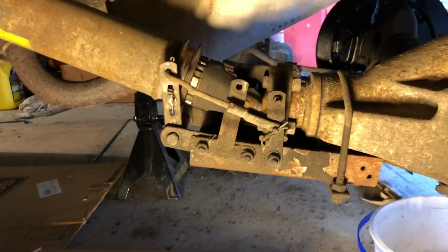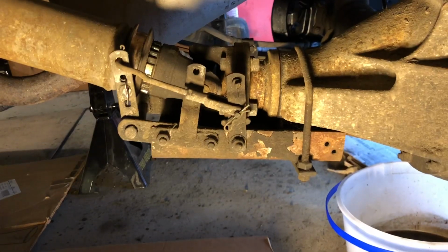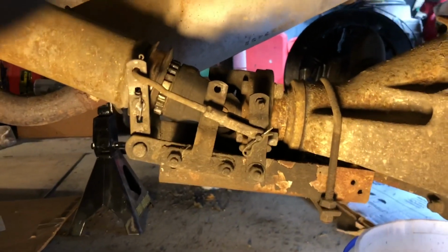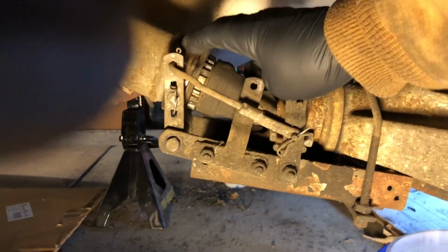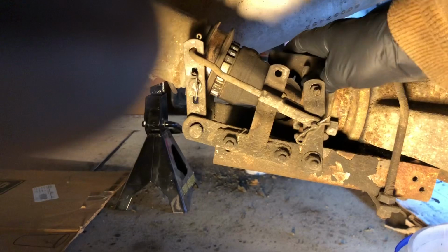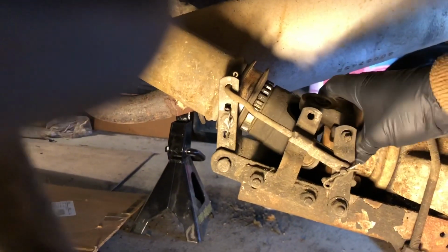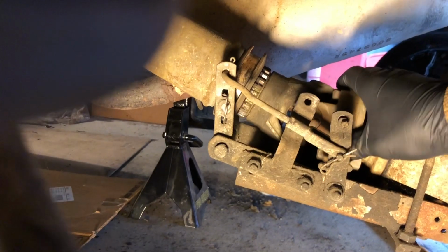So here is the driveline disconnect that was added to this car. It's an aftermarket Remco, and this is a mechanism that attaches to a cable pulley in the cabin. When you want to disconnect, you pull the cable and it slides this collar back and forth, grabbing these teeth, so that the rear end spins independent of the driveline. You can see here it's disconnected. I can spin the rear wheels, but it doesn't spin the driveline into the transmission.